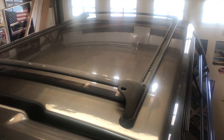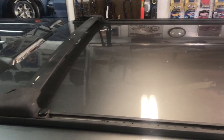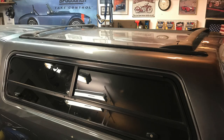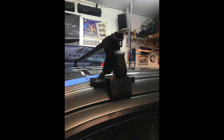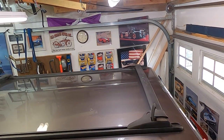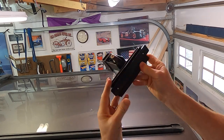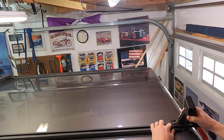So this is the $18 rack fully installed. I had plans on repainting it before or after installing, but I never did as you can tell. Because I have the super crew version of the Ford pickup truck, I needed a crossbar to go over the front of the cab, so I picked up a couple of Thule bars from Craigslist for $30. Then I modified the rear bar to go in the tracks on the topper — I threaded some one-inch strap steel to slide in the channel and used some half-inch strap to make the tensioner to hold the bar.